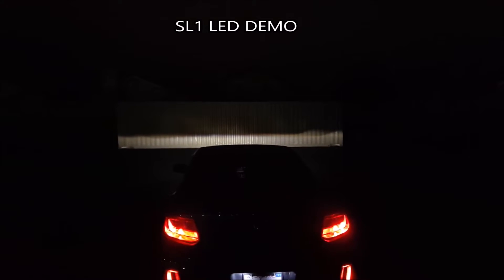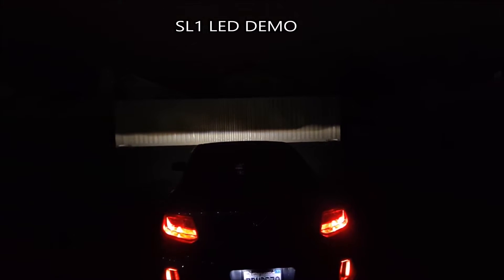Here's a nighttime demo of the SL1 LED headlight bulbs. This right here is the cutoff and the light output — I'm currently parked 40 feet away from that container. Here is a close-up of the cutoff. It's not very even all the way across; there are two little slopes on each side, and there is an intensity hotspot in the middle. The LEDs are in the optimal position inside the headlight right now, so even if I were to adjust it, that characteristic is likely still going to be there.